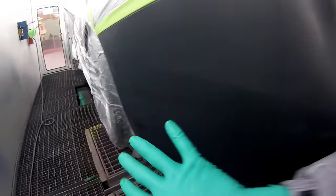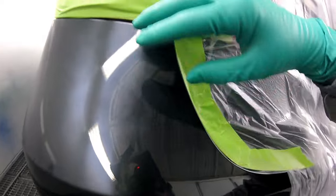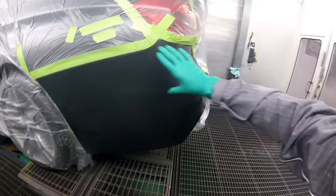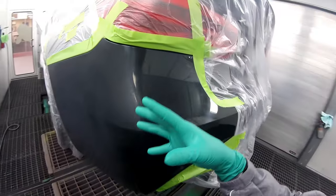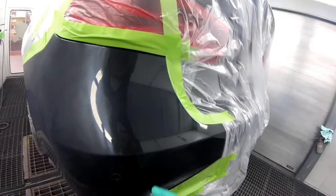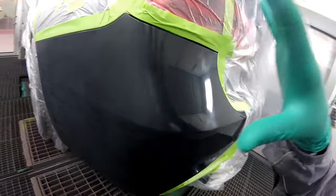So we got 800, 1,000, and 5,000 grit. I'm not sure if you can see the fine scratches, but I got 5,000 running all the way over here. When doing a blow-in, here's a really, really good tip for you: give yourself lots of room. Lots of room equals a beautiful finished product, because you're not trying to create miracles — you're already trying to do the miracle of blending that edge for the whole entire repair.